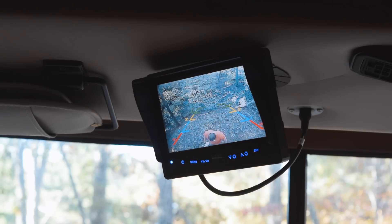So that was a lot of cable management. I was actually about a foot too short, but luckily this hooks into the existing backup camera — I'll leave a link to that video below. What makes this cool is it hooks directly into that camera and shows up on the monitor up front. You have to get to the camera wire so you can put a Y-connector in there, which allows it to show up on the monitor — super cool, unless you don't have enough wire. I had to go back and fish about another foot of wire from the backup camera, which was no big deal.